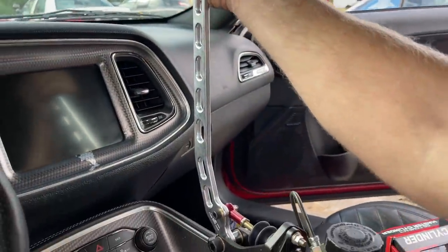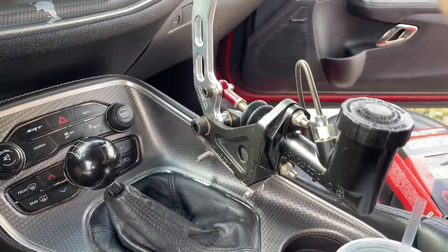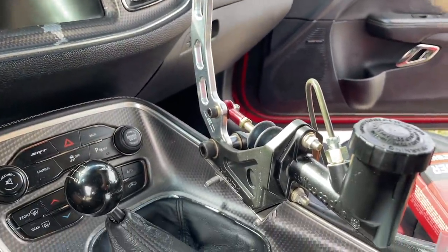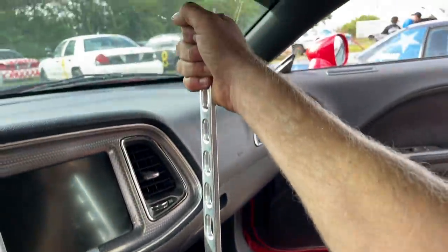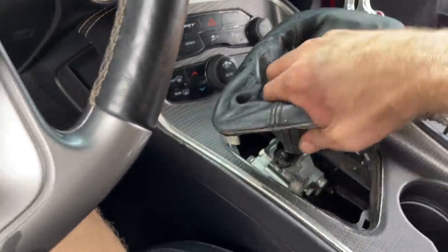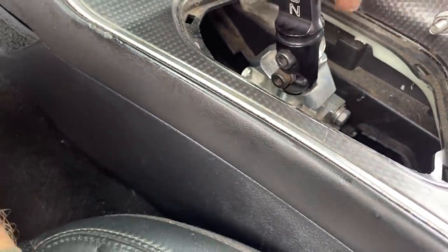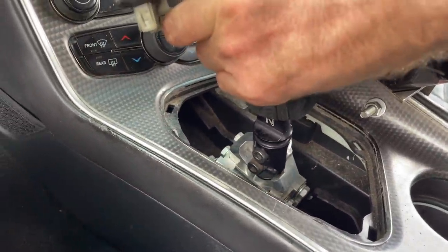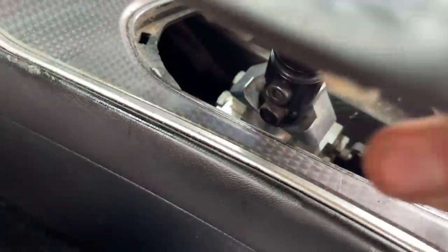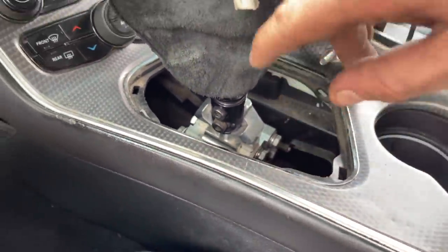She's looking like she's got a lot more action in her. Still not bottoming out on the cylinder, which is good, but I can pull it back two to three times as much, which is what I wanted — I want to be able to skirt. Another thing that happened is I was slamming gears and this short shifter wiggled loose, so when I was shifting gears it would travel like twice as far without even going into gear. All it is is this screw right here is loose, so I just need to tighten that up and be ready for some burnouts.